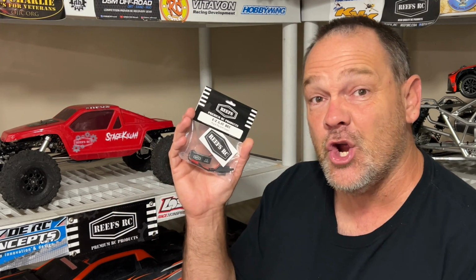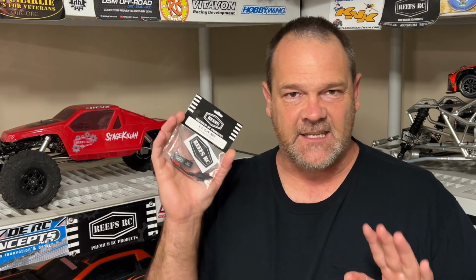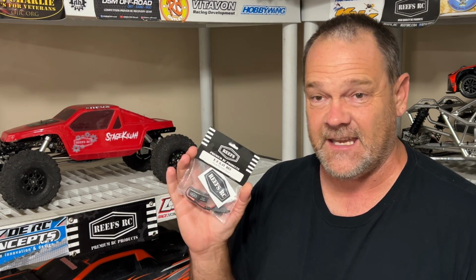Guys, this is the brand new Reefs BEC. Now, this is a direct plug and play style BEC, right? You know how in the crawler world we were talking about, if you're going to run high voltage to your servo, you've got to bypass the receiver. It's all built in. Plug and play.